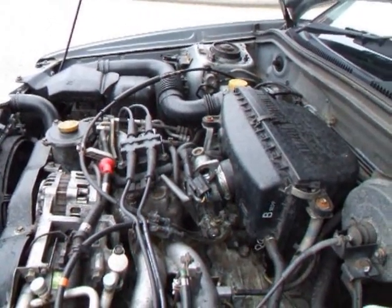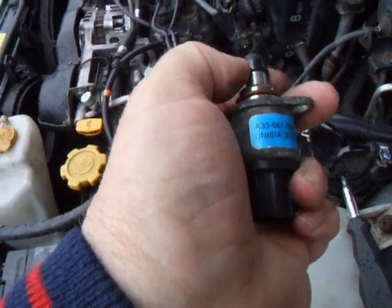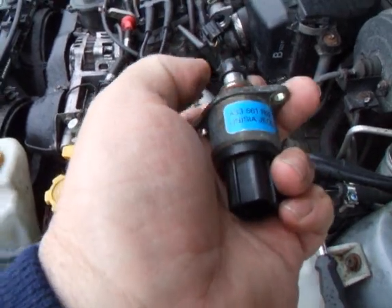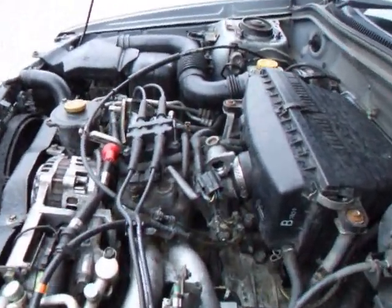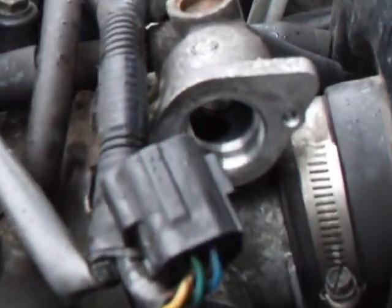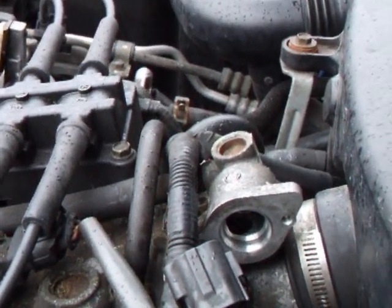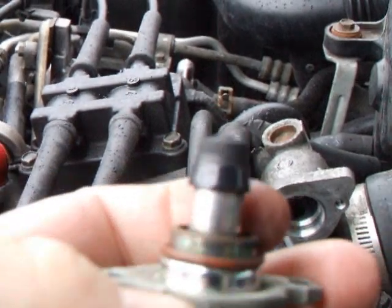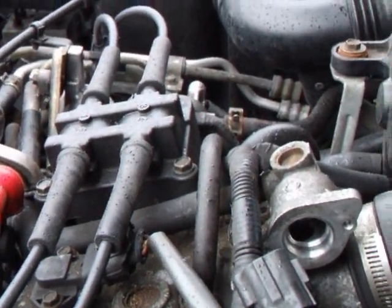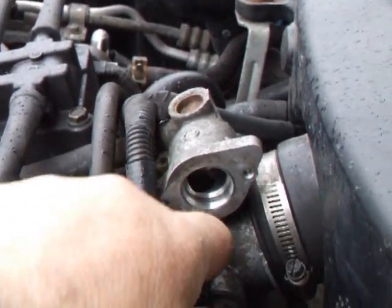I'm going to get some kitchen roll. Obviously we want the surface that this piston goes in and seals into — at least we want that to be clean. Otherwise it's not going to seal. And if it's not going to seal, I presume here it gets past it, then there you get your poor idling. In my previous video this was so black you'd question whether it was moving at all. In which case you would have the stuck position and every time it would come to a junction it would just conk out.